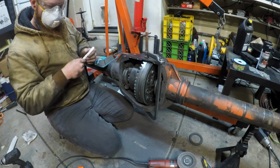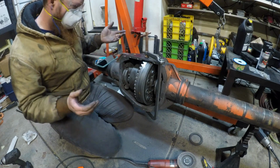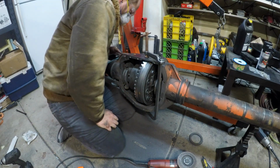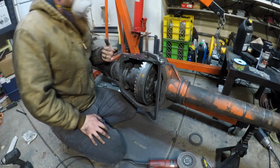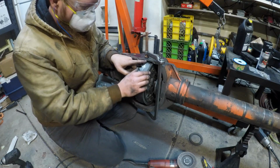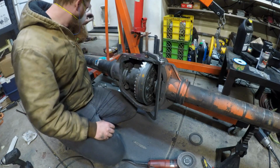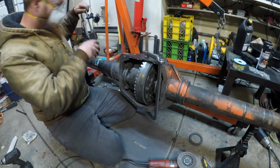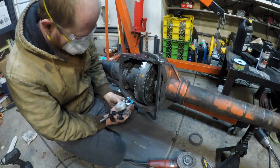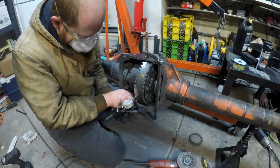So, we're like a thousandth off of the nose. So, plus or minus 10, that's where we're going to get it. If we did a 66 thou shim, and it always fit when we spun this ring gear, then we would be golden. And to figure out where we're not hitting the mark on that, let's put this back on.